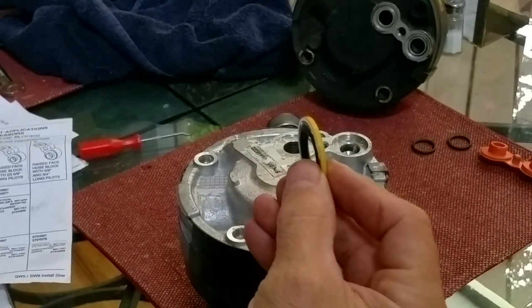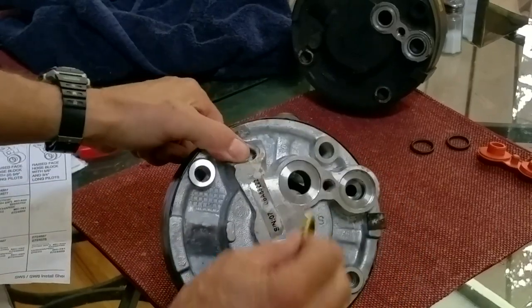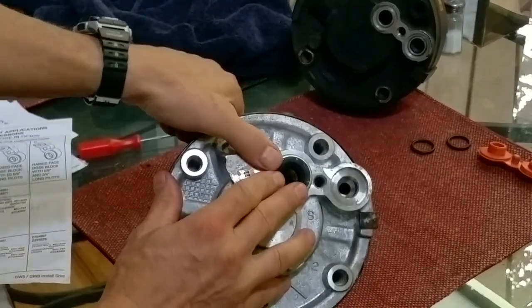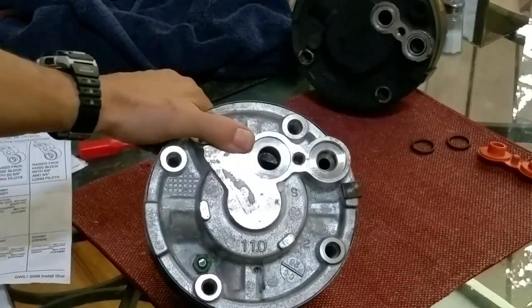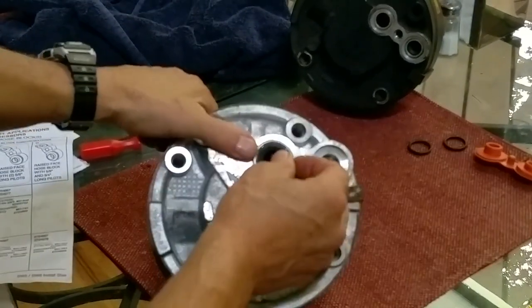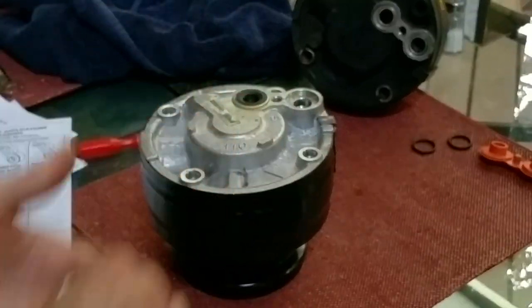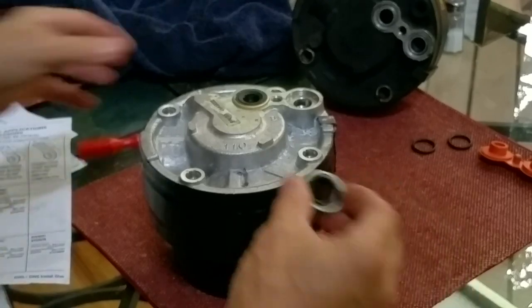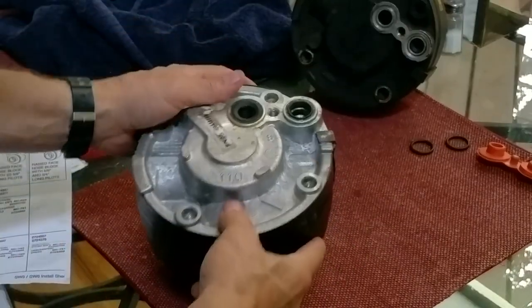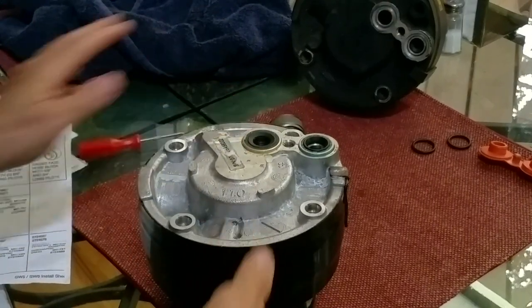Here's the recommendation for my compressor: I'll need the yellow and the green sealing washers and the short insert. The yellow can only fit in the larger overall hole — it wouldn't even fit inside the recessed area of the smaller port. The green sealing washer goes in the other hole.